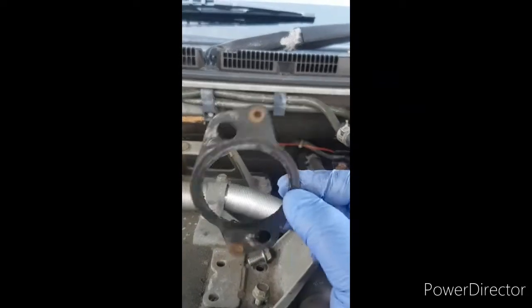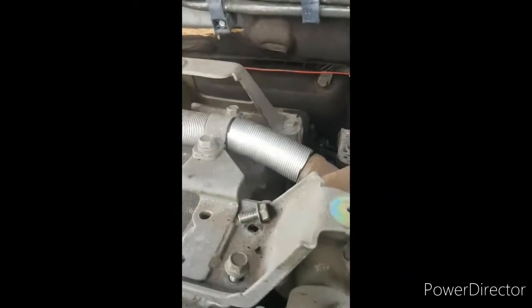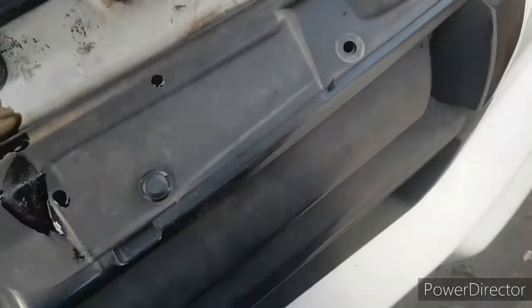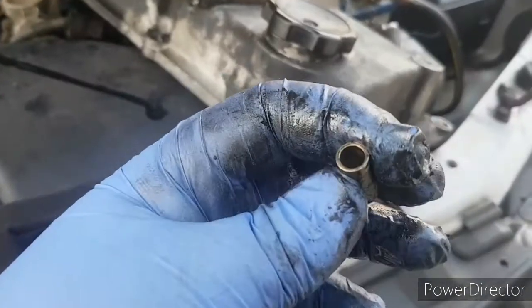It does go that way - I don't think you can really get it confused too much, but you know, that's the way it goes out of there. Just another little tip I'll add of my own: the bolts that go with all the rocker cover have like this sleeve that goes in there. I imagine it would be quite easy to lose one or two of them - luckily I noticed they were there and I was pulling them out as I went along.